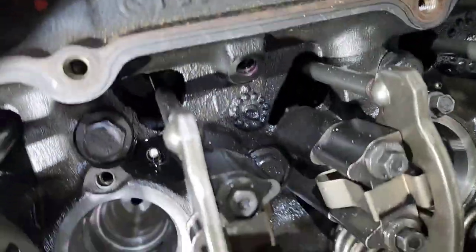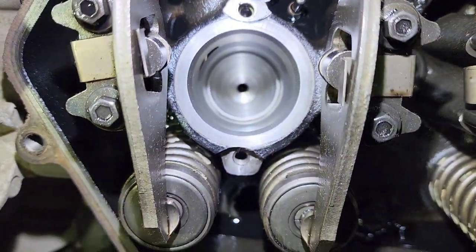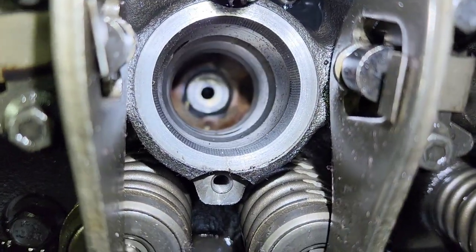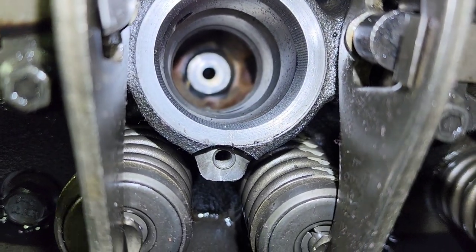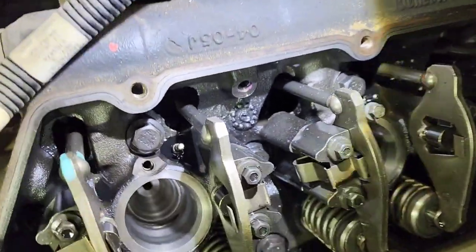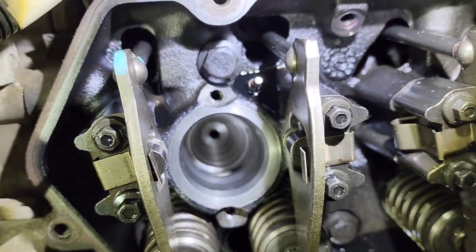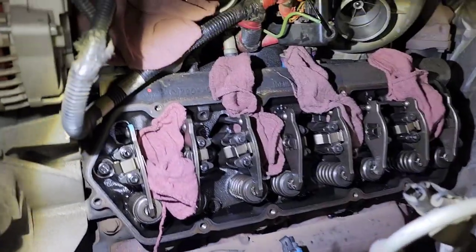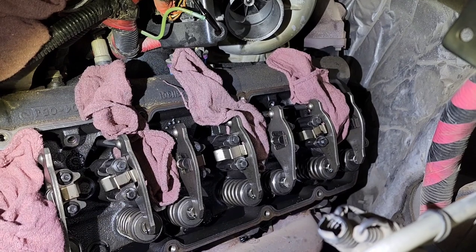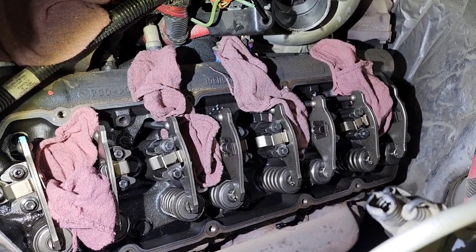Once you're all done, your cup is installed and all clean — that's what it should look like when you use the stainless steel cups from Riffraff Diesel. Looks really good. Before you put the cup in, sometimes you've got to take a pick or screwdriver and really run it around the bottom of the bore to get any old Loctite out. Even after using the bore brush, knock out big chunks of Loctite with a screwdriver and make sure it's clean. Once the cups are in on this side, I like to stick rags back in the holes to make sure no oil runs down the cup and compromises the locking compound.